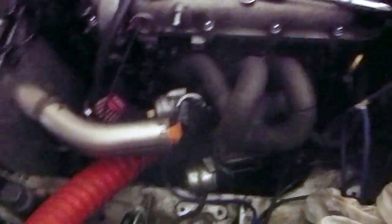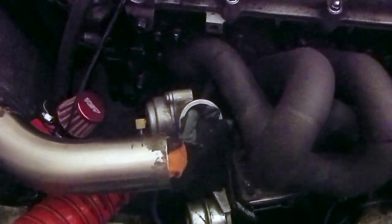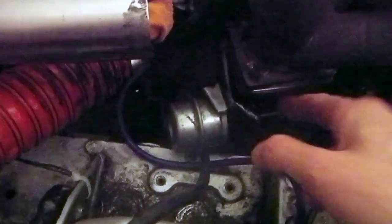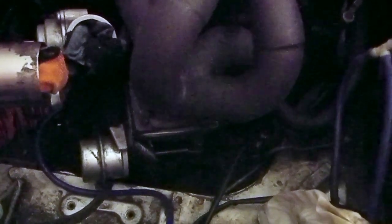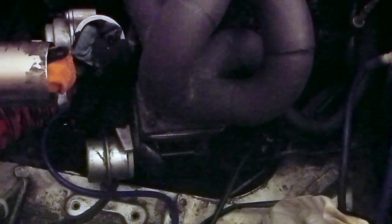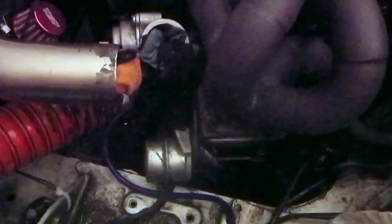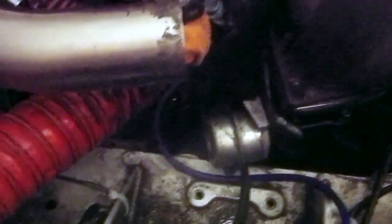Welcome to the garage, day two. This is Tobi again - introducing pain-in-the-arse manifold and turbo mate-up level success. After much fighting, I've managed to get the manifold to mate up with the turbo flange. It required a trolley jack under the car to jack up the downpipe. This is a complete decat setup - no catalyser - so from the turbo joint it goes straight into the downpipe, into a flexi and then the rest of the system. There's quite a lot of weight hanging off this. Probably when this is done I'm looking to get a turbo brace, because that's probably why the manifold cracked in the first place. So I'm going to get the nuts back on these and everything tightened up.